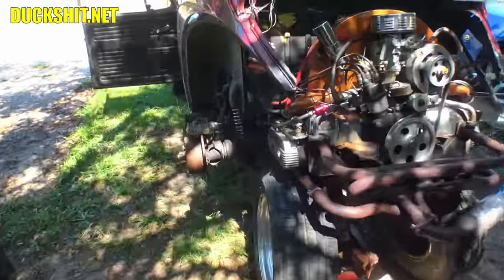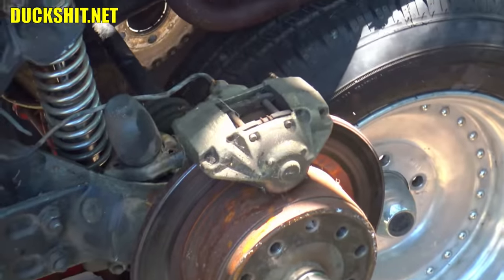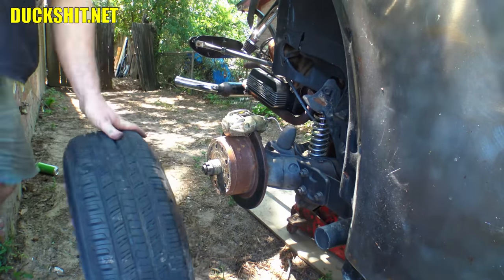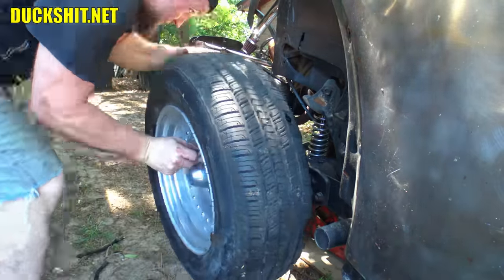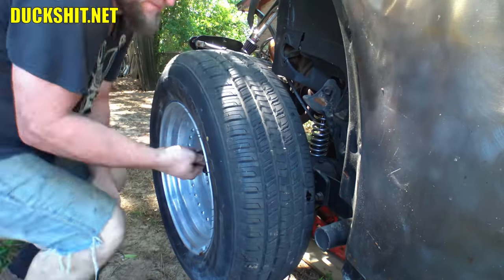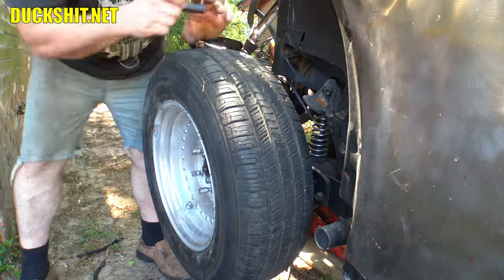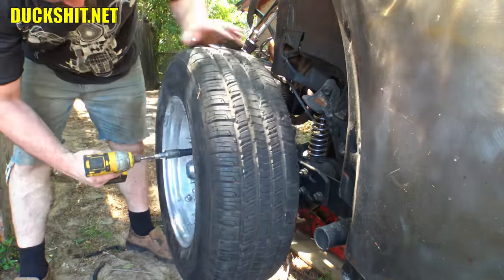These wheels are a little odd — these are actually front brakes installed on the rear. They don't have any provisions for an emergency brake, so the emergency brake handle on this car doesn't work. Somebody was probably trying to save money — I think this disc brake kit was about a hundred bucks cheaper. Nonetheless, this is what's on here. Rob just needs to understand to leave it in gear when he parks it.